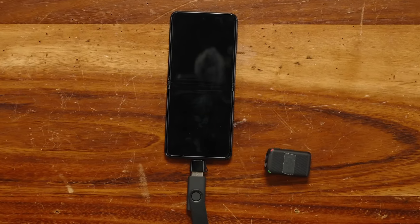So I'm gonna first start by plugging into a USB port that I did not use. Oh, snap. No charge. Okay, let me try the other USB-C. Oh, that's bad. Both USB-C ports are not accepting a charge. Now, before I try USB, I wanna try connecting via MagSafe to see if maybe that works, since that is a physically different connector. So, ready, and, ooh, that looks good. Ooh, no, it's not. The MagSafe cable thinks that the device is fully charged and good to go, which seems normal, but the system says it is not charging right now. So none of the USB-C ports or the MagSafe work.